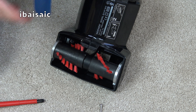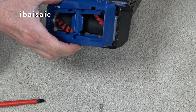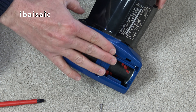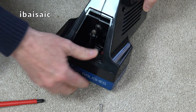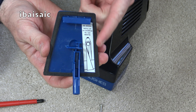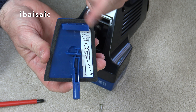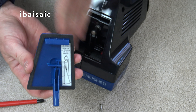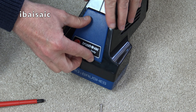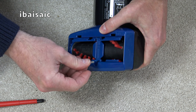I did manage to get some belts at one point, but I haven't found any since, so I'll need to try and get some more. Once the belt has been replaced, you pop the base plate back. You can see on the back of the front panel there's a little diagram, similar to the Hoover Junior, just to show you which way the belt goes on - because if you put it on the other way, it'll just slip off as soon as you turn the cleaner on. Then we can do up the screw.